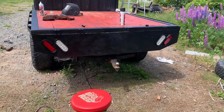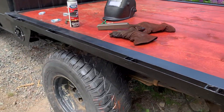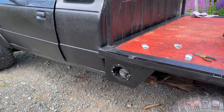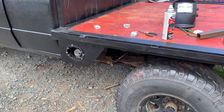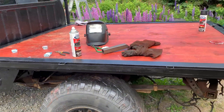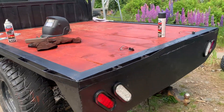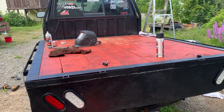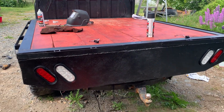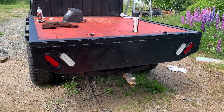She is starting to shape up, as you guys can see. I'm just fitting the lights here — I know I haven't been doing a whole lot of filming. Got the gas cover in place, she's painted up a bit more. Put a few self-tappers just to hold it in, doesn't need much force. Got these back pieces all painted up. I'm putting these in place and I'm going to silicone around it as well — just helps keep the lights in place and keeps water out. Some little bit of clear silicone, but I am liking it.